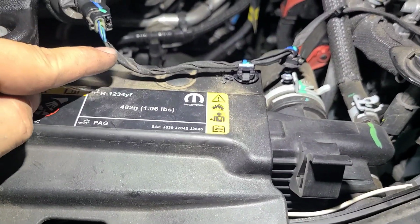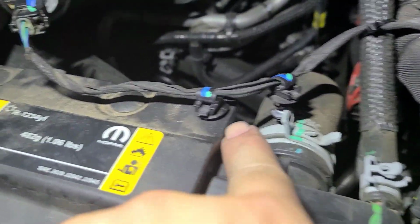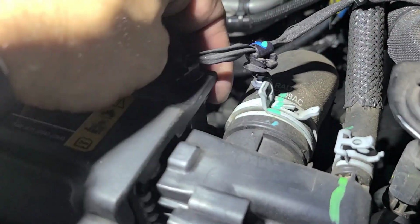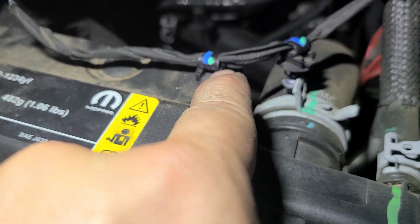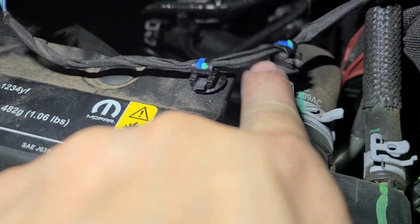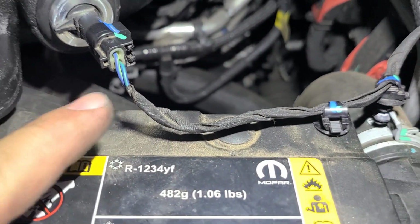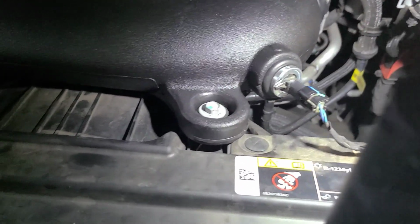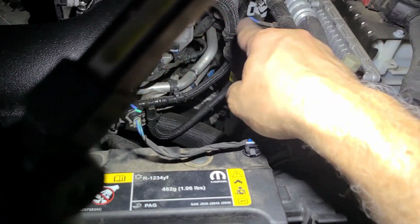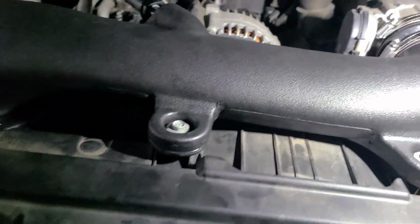I drilled a little hole right at the edge here. Don't go over here. Make sure you're not drilling through the rest of your shroud and radiator. Right on the corner, so I reused one of these guys. This guy's just floating here for now. Zip tied it here. So this is kind of the only thing I don't like. It's kind of exposed here. Previously it was a little bit more shrouded over here. We're not reusing this holder for anything either, but it's okay, sturdy.